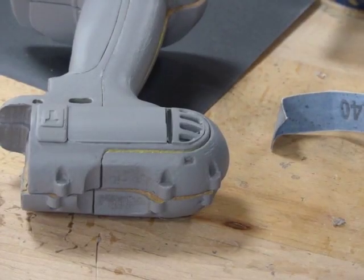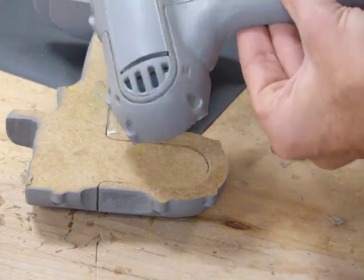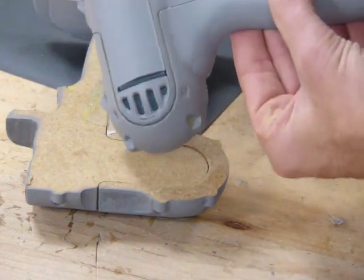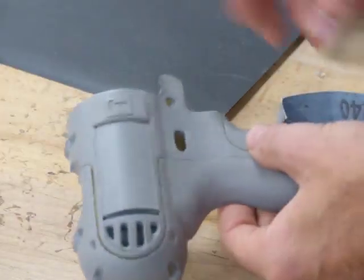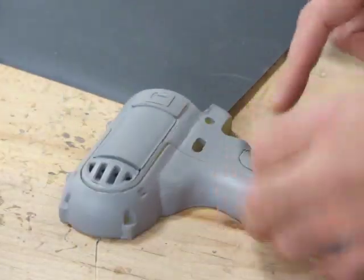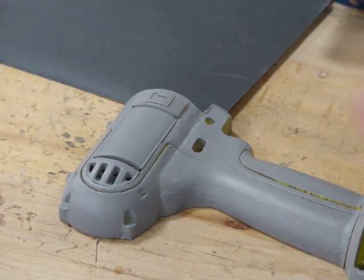At first glance it looks pretty good, although when you look carefully and you hold it up to the light, you can see the surface is still a little bit rough and pitted. So the first stage is to just give it another little sand down. Be prepared to lose the grey and go back down to the yellow. It's spray filler, so we're just kind of filling in the bottom troughs, the valleys, and sanding off the peaks. Hopefully it'll just be one job, one coat, and then another spray coat should get it nice and finished.